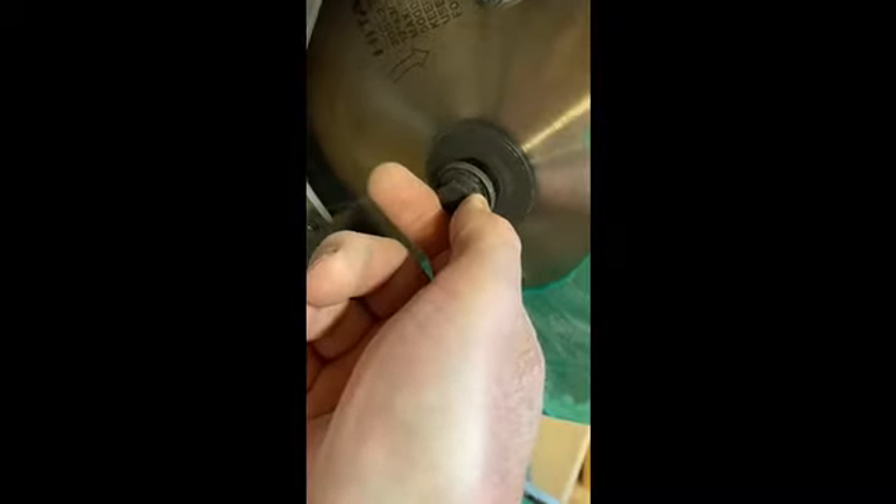You can see here there's an arrow on the blade that tells you which way it rotates. So basically, in order to loosen it off, you go in the same direction as the rotation of the blade. Behind it is a washer. You can pop the washer off and if you notice, it'll fit over the shape of the shaft there.